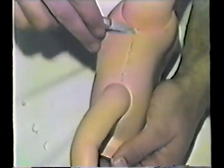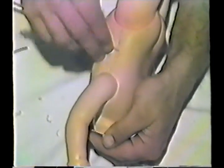You can see we have a little bit of a hole left right here. Take a little bit of the glue, being careful not to touch the tip to the body because the tip is hot enough to melt the plastic. But you want to squeeze a little more glue in place, then use your knife to work it down in that hole. That'll seal it up. If you still have some rough edges, you can either scrape it with the knife or you can use an emery board to file it down.